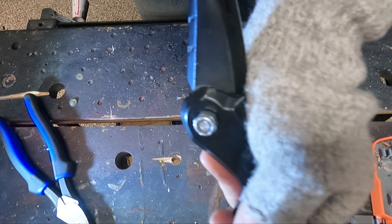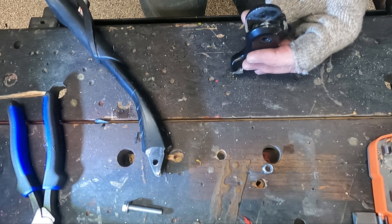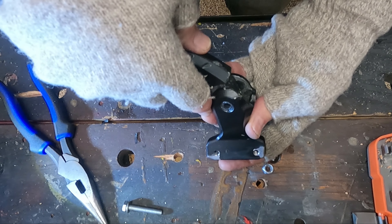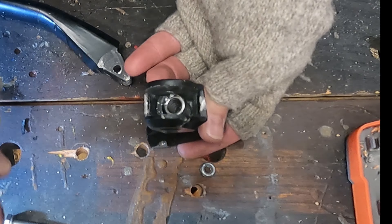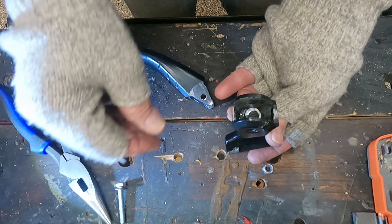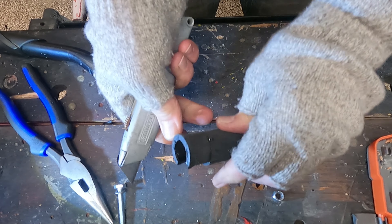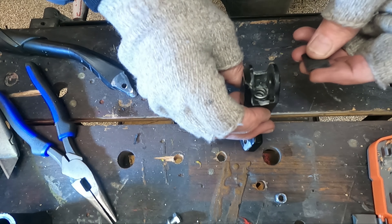I think grinding that spring down really helped. I think I'm onto a solution — or at least I know what the problem is. The problem is this spring goes back and forth when it just needs to go up and down based on the kickstand opening and closing. So I've got a thicker spacer on that side and I'm gonna put another one on that side. I'm getting closer. I'm just cutting up rubber shims off the little rubber handlebar grips to go on the other side.